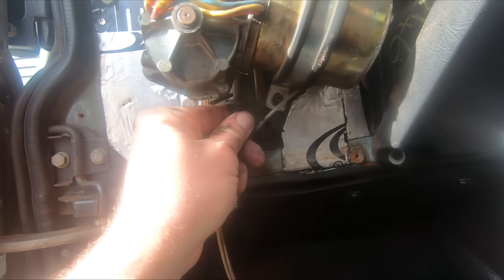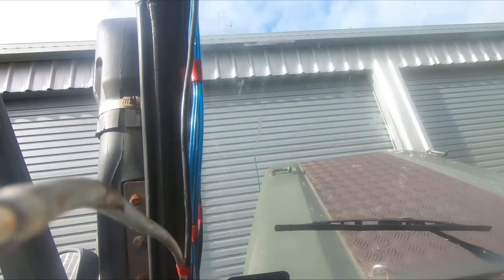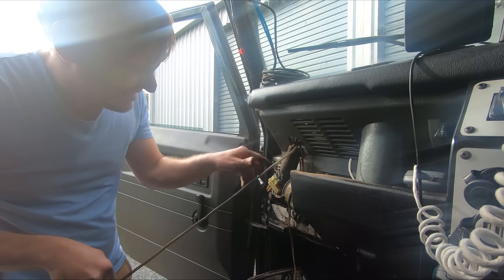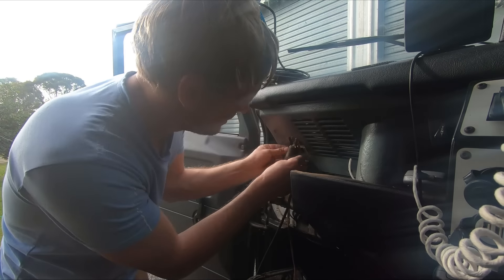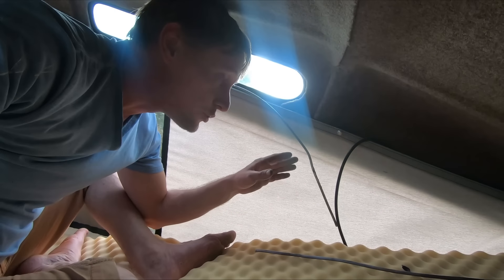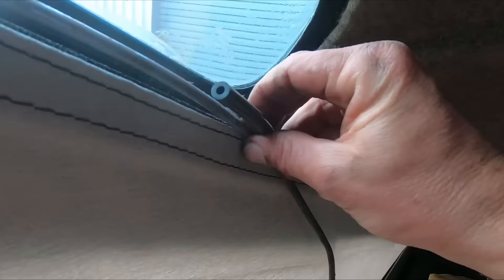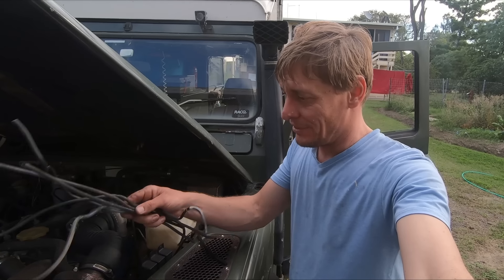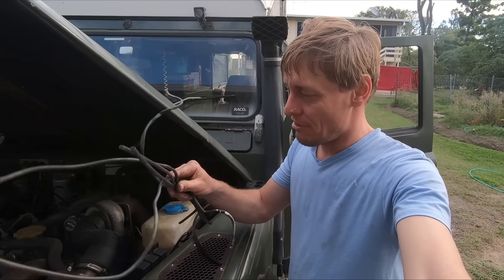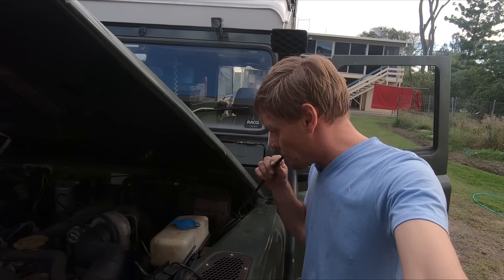Thankfully it's easily accessible — I should be able to pull this out and put the new one through. Easy access goes up through here, folds out along the gate pillar and then up at the top. The new three-metre length makes it most of the way up into the roof, so I'll be able to cut out some of the old stuff and just make it neater. I've ordered a new one-way valve as well as a new pump — the previous one-way valve, I couldn't seem to blow anything through either way, so I'm guessing that may also be faulty. It should be a good overhaul for the rear system — it blows all the way through now, so it's working. I just need the new pump to get it back together.